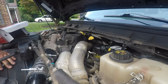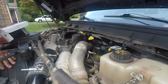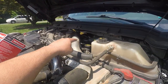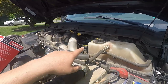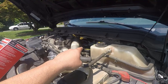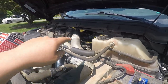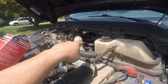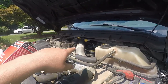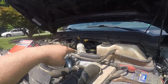For the earlier style trucks that have a third prong coming off the fuel filter, they also have a band clamp that goes around the housing — I believe it's a 7 millimeter. A lot of people come at it from over here with a little 6-inch extension; there's a nut there, just loosen it, you don't have to take it all the way out. The connectors are still the quarter-turn style just like this, so the only additional thing for the earlier style trucks is dealing with that band clamp.